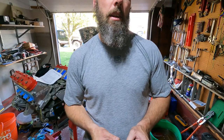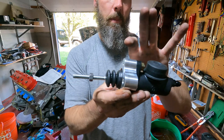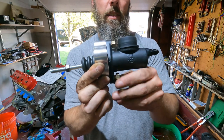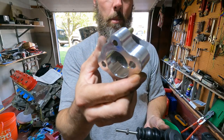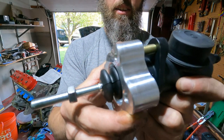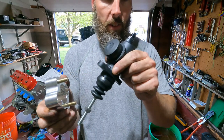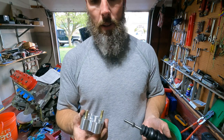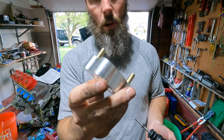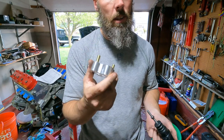We're going to start installing the new master cylinder. As per the directions, you are removing the master cylinder itself from this aluminum bracket - they come loose already. Just back these nuts off and separate it. We are successfully separated. These studs are going to sit up top just like that. Once you get this in, it's going to slide back in and hopefully work as described. This is probably going to be a nightmare, especially trying to get a bracket on while fishing this thing in. It comes with new hardware for the studs that go through the firewall - save your stock hardware just in case.